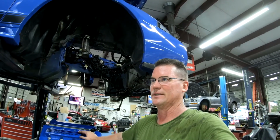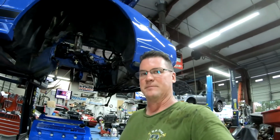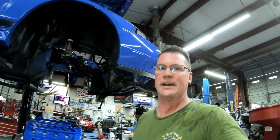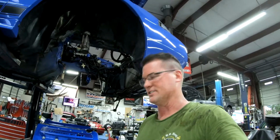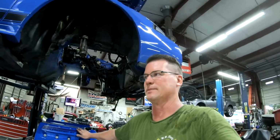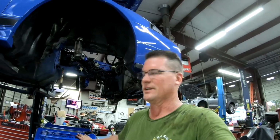Of course, here comes the four-wheeler. All right. It's got a set of L&M cams in it. It's got a set of Comp Cams beehive springs. What else is important on this? It's gonna run E85, so with the extra compression, which is 1.5 points more than factory, which is 8.5-to-1, and the cams, this thing should be pretty fast, should run pretty good. I've got my VMP supercharger gonna go on it. It's a little 2.3, but I'm gonna spin it. It's gonna make about 24 to 26 pounds of boost. So I feel like the car is gonna make somewhere about 800 horsepower, maybe through the auto. If it was a manual, probably make a little bit more, but that's okay.